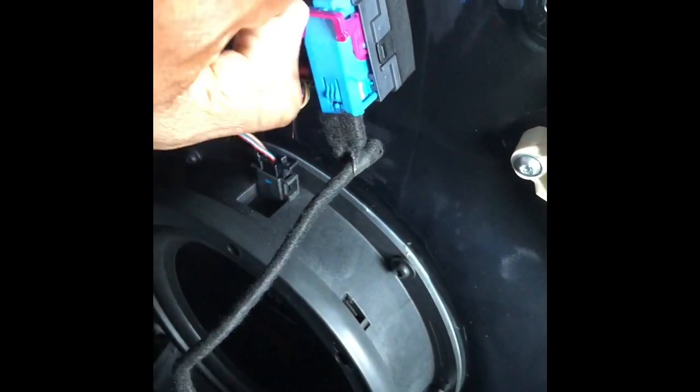Push in on this tab and just come up. You want to take this off — this is your door handle that connects under this ring. This plastic piece is snapped on here, just pull it from the back. Pull it up until it snaps off — just be careful, don't break the plastic — then unhook that from under here and you can remove your door panel because you got room to work for your actuator.